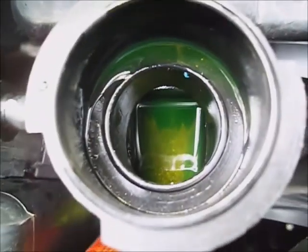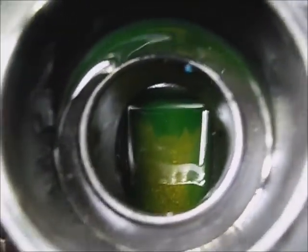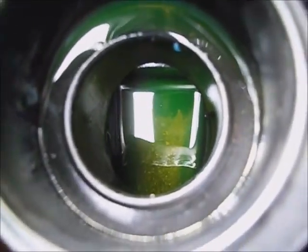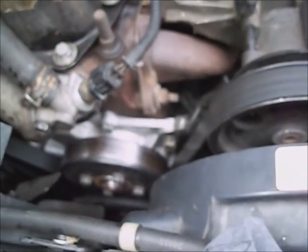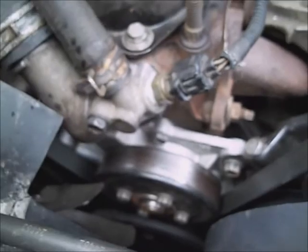I'm gonna shut it down and let it cool off and drain the antifreeze out of it after it gets cool. Before putting a new radiator in your Jeep, flush it. Flush the Jeep. See all that debris laying in the fill neck. That is throughout the engine and it will stop up your new radiator and or stop up the cooling effect the antifreeze has on the motor.